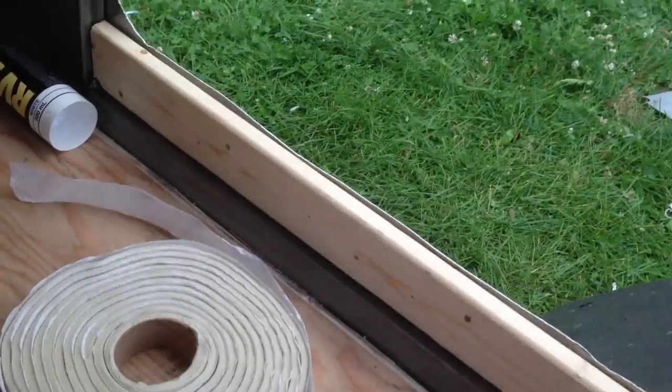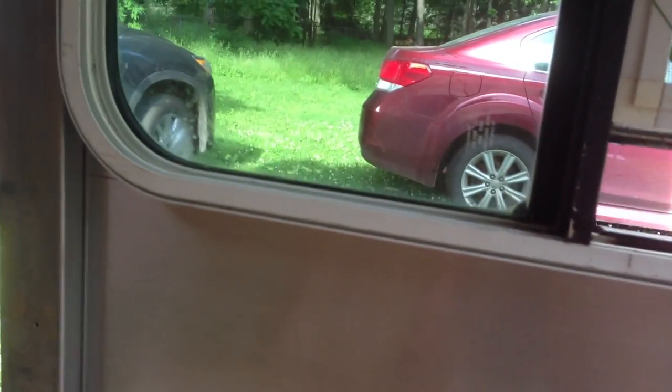Those pieces of wood are going to be extra strength. I've got a tube of caulk — I'll caulk it in behind there. I'll also zip a couple of screws from the side, and then I'll be able to screw the bottom and top of the door frame to that. The main thing that's going to do is keep the side from shaking as it's going down the road. You don't want that caulk to loosen up. So that's the project I'm working on today — getting the window and the doors set.